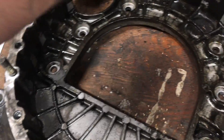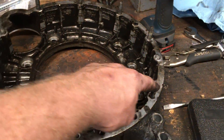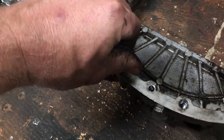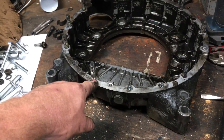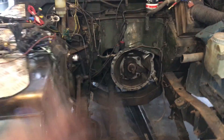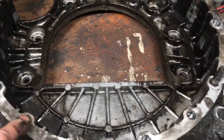Each of these lines up exactly with the bolt pattern of the transmission and the bell housing that's still in the truck. These do not. This one here I've set in place — this is going to be the one I go ahead and mark into my template so I can take it over to the bell housing and drill out the hole I need. I'm doing it this way because I don't have the proper metric tap in my tap and die set, and since drilling into the bell housing is far less precision — just a hole where the bolt has to go through and a nut keeps it tight — it's much easier that way.